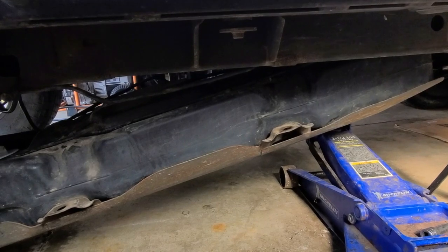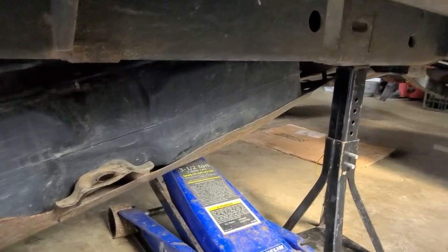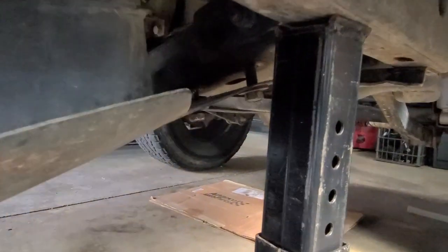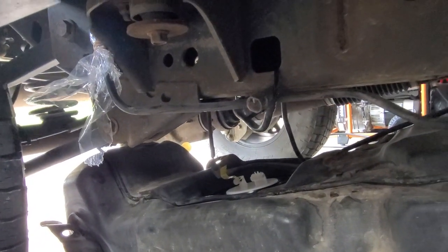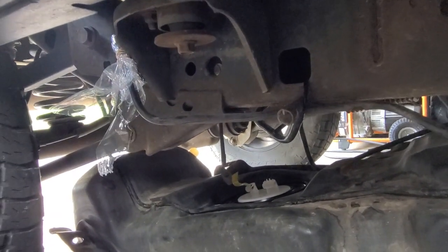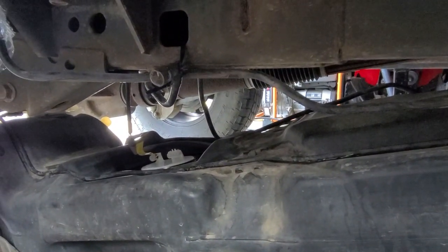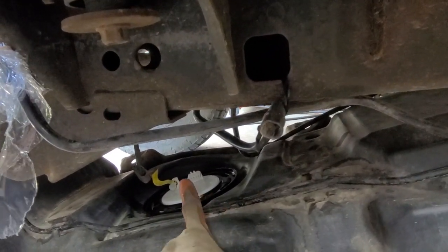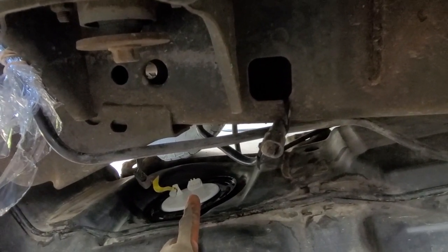So from under the car, what I did was put the front of this on a jack. It's not that heavy, but just to make it a little bit easier. And then I got these front two bolts here just loosely put in to hold it in place for me so that back here I can reconnect all the wires and tubes without a whole lot of slack, and then just lift this end up and then put the bolts in the middle. It makes it a little bit easier to do. When it's down on the ground, especially when it's up on a jack stand like this, the tension on these cables going to the fuel pump's pretty strong. So I wanted to make sure I didn't make any more messes for myself.